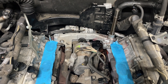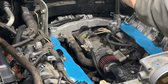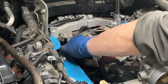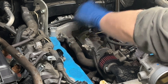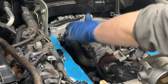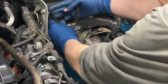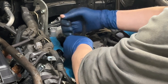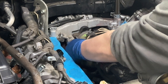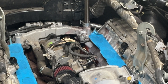This pipe is not budging, which means we're still connected to the air injection pump plumbing, so I'm going to go ahead and disconnect this clamp here and cut this hose. I'm going to have to get a new hose for the air injection system. I need a knife to cut it because it's not going to come off on its own — yeah, it's not going to pull off, this hose needs to be cut because it's so brittle.